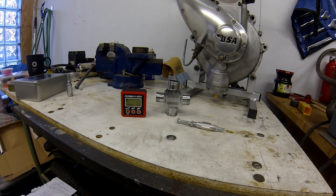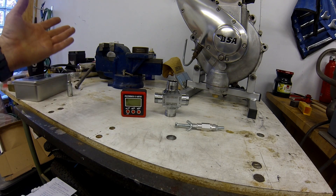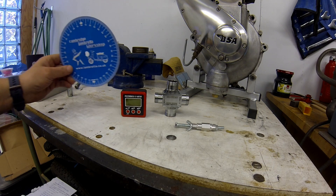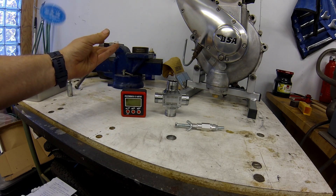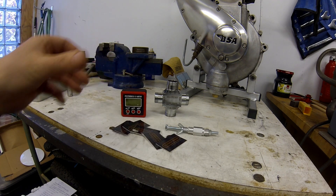This tool is pretty good value for money. I've seen a lot of people complaining because you can get an enclinometer or digital protractor cheaply, but it's the platform that does it. And if you don't have a top dead center tool either, it's really a no-brainer - you're going to spend the same amount of money anyway and you won't have the tool or a proper way to secure it to the scooter. So you can basically throw away your old degree disc. Yes, it's more expensive than a degree disc and a piston stop, but if you like to mess around with scooters and you're the go-to guy in the club for mechanical stuff, then this tool is fully recommended. I want to give it 10 out of 10 Kickback Garage stickers. See you in the next video.